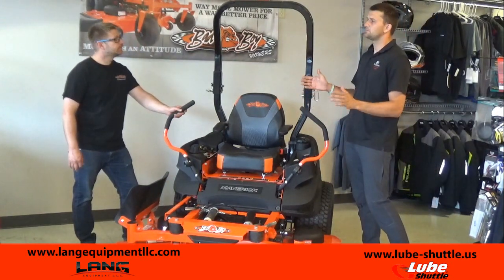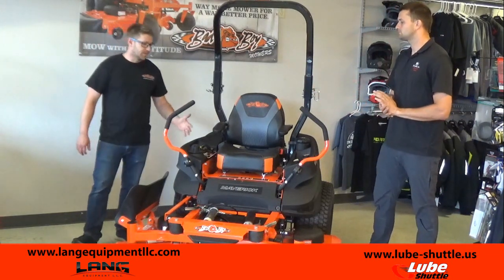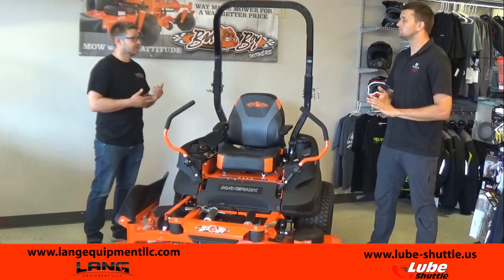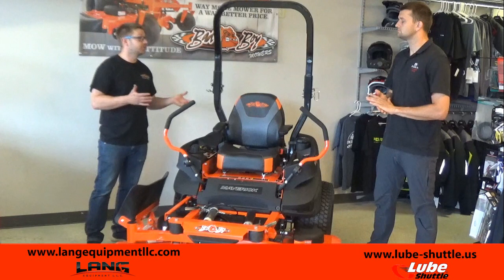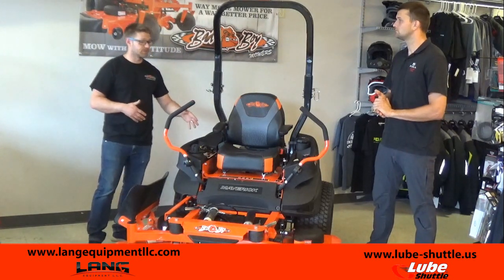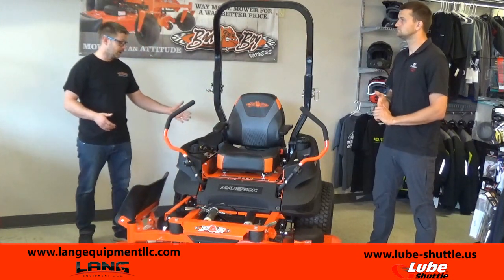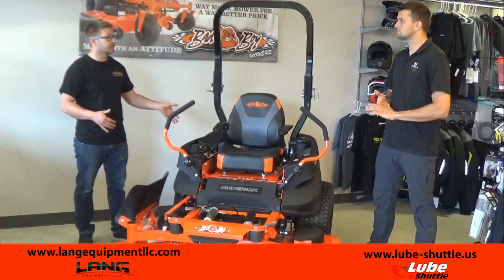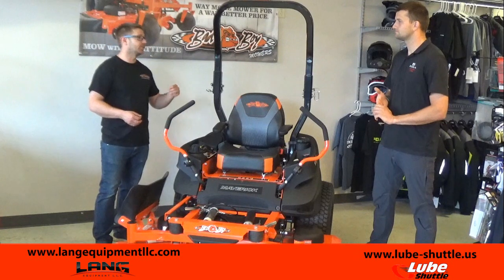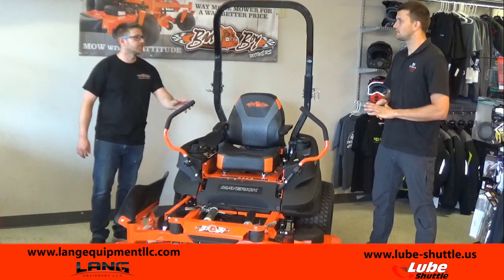Now, what are some of the things that people could do, or what are some of the things that people should just bring the machine in for? Some of the things that you can do on your own, really, are the engine oil change. That's a pretty simple one. Some people do choose to bring it in for that. Every time you change your oil, you've got to make sure that you're lubricating those greasers everywhere on that machine. They're found in the owner's manual. Doing the hydraulics, it's a little bit more of a challenge for people, but yearly, just checking out those spark plugs, making sure you're not running too rich or too lean, that's something that a lot of guys will bring to us to have done.